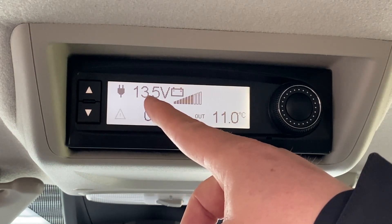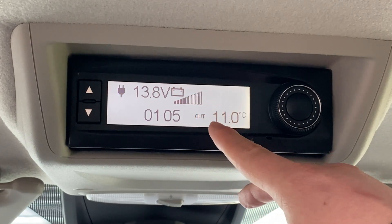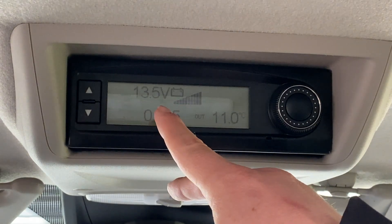It is important that you recharge the batteries as soon as possible after a big discharge. The control panel symbol shows when the 230 volt cable is connected to the van, and the bar scale shows the battery is charging. When power is disconnected, the display shows the level of charge and the number of volts. The manual advises to charge: before a journey; during a journey if lots of power is used and not much driving has occurred; prior to long periods of not being used; or otherwise schedule a four-weekly full charge for 24 hours or longer if you've had a significant deep discharge.